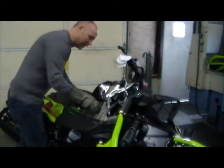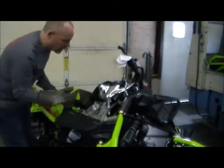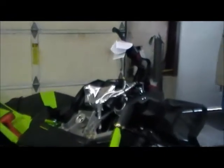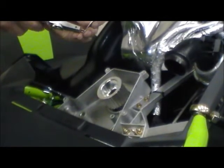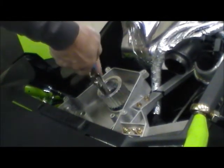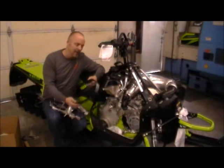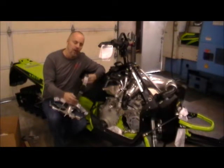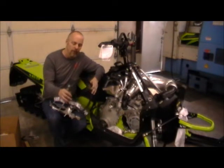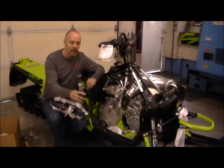I'm back with the pulley out of the oven at 500 degrees. Slide it on your shaft, should seat. Grab the snap ring that was against the washer, don't burn yourself, and put it in. We've given the pulley a little bit of time to cool down. Now is the time to install the belt. It really doesn't matter which way the belt goes on, but the carbon cords actually do form a direction, so you want to put it on the same way every single time. I just put it on to where I can read the letters.